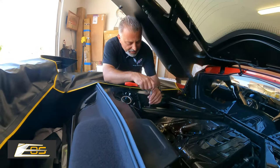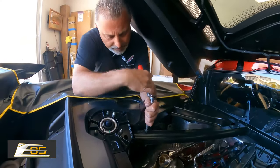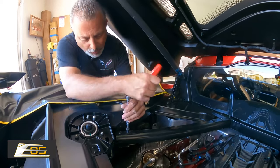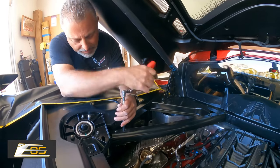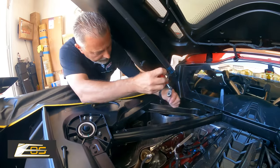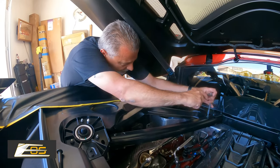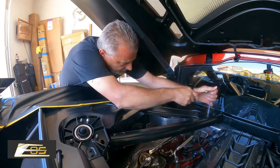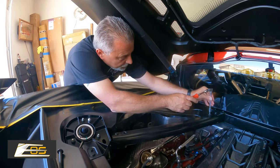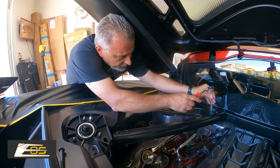We are on the opposite side now. We're just going to go ahead and take our screws loose. I call this a screw. It's actually a pretty good sized bolt, actually. But they come out pretty easy. Again, this one is a little bit of a reach for short people. You want to try to keep both hands on this thing and not let your ratchet go crazy, because you've got a piece of glass over here and you don't want to take the chance of busting that glass.